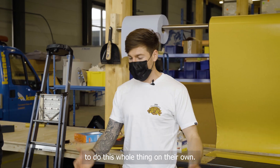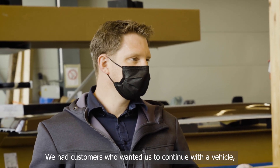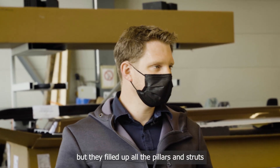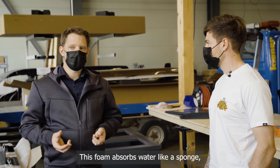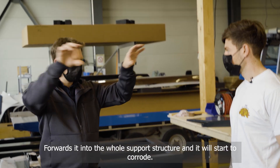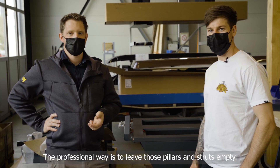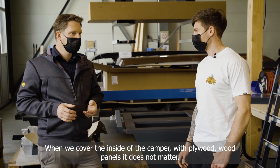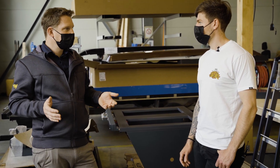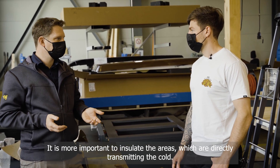What do people most often do wrong when they try this themselves? The first mistake usually happens during insulation. We've had customers come in who had sprayed all the pillars, struts, and everything with PU construction foam. That foam acts like a sponge — it draws water into the entire load-bearing structure and it starts to rust, guaranteed. The professional solution is to leave those pillars, struts, and roof bows empty; they're also useful later for routing cables, and you'll always forget a cable and be glad to have somewhere to pull it through. When cladding the interior — whether with plywood, wood paneling, or anything else — it gets closed from below with an air cushion above. What's more important is to insulate the surfaces that directly form cold bridges.